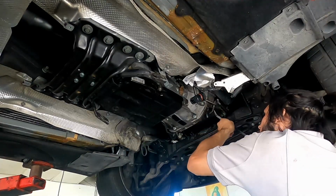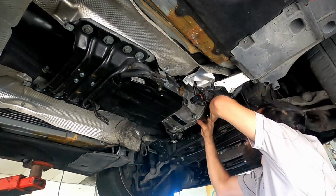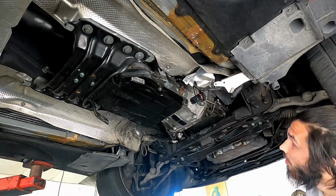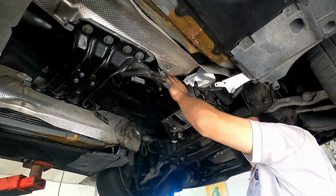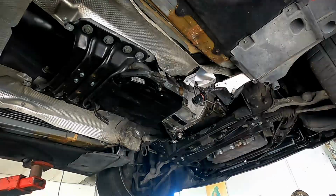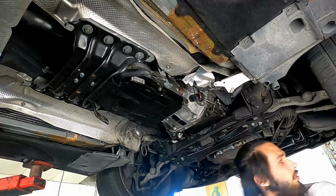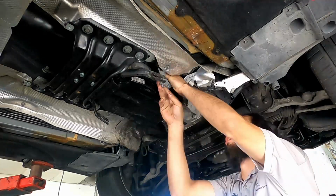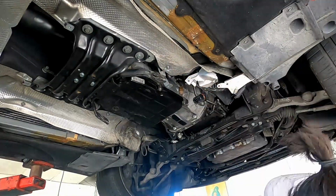So you buy the dipstick and you let the vehicle warm up, you put it between all the gears, park, reverse, neutral, drive a couple times, and you add a quart at a time basically. Once that's done, you just check the fluid. Make sure you have that on hand, or else you're not going anywhere afterwards. It really just depends how much fluid you lost in this whole transaction. If the torque converter got stuck like it did for me, I actually added about 3 quarts,